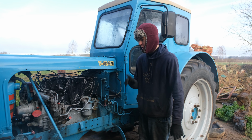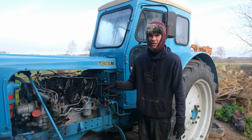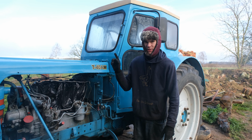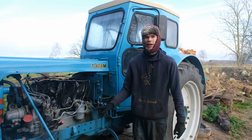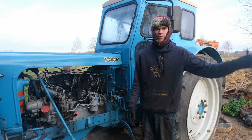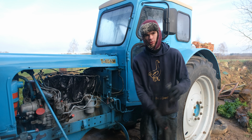We're gonna continue. We have to take out all the pistons, and by taking them out, we need to take out the pistons together with the rods. So we have to take off the oil pan, leak out the oils from both engines. I hate it because it's like 30 screws holding in the pan, so it's quite a mess to just get it out, and then it's just 8 screws and we have all the pistons out, and then the same on the other tractor, and then swap them in there, and hopefully the green tractor we can assemble it back and start it. If that doesn't work, then I really don't know what's wrong with that guy.